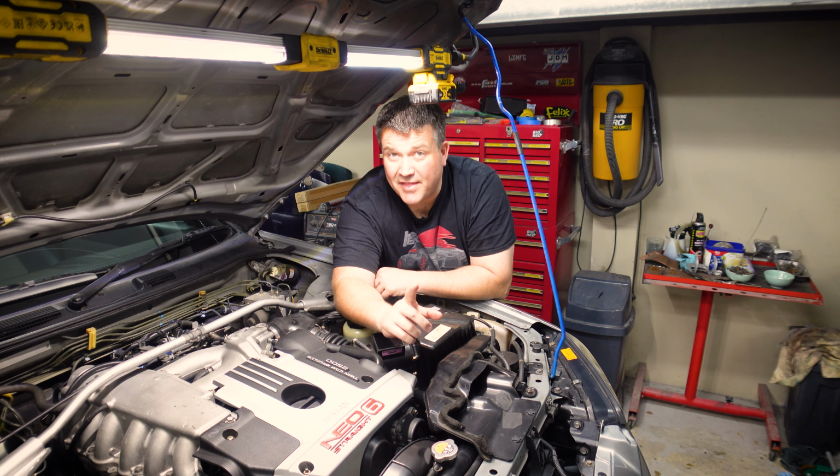in its hot position. Now, as I said before, the capacity for the Auto Trans is supposed to be 8.3 litres on the RB25. It's only 7.9 on the RB20 versions of this if you're playing with one of them at home. But the manual does also say when you're flushing these engines, you're probably going to use between 30 and 50% more to get the fluids all the way through. So I have 12 litres of fluid and I'm gonna need somewhere between 10 and 12 litres.